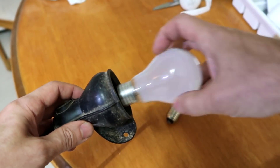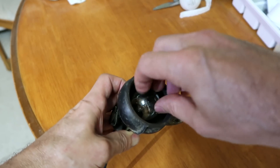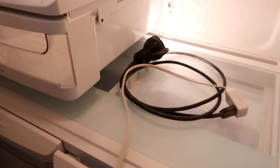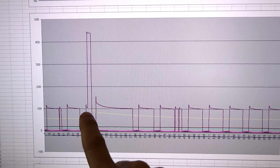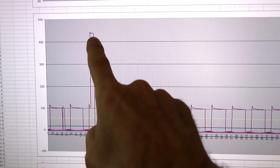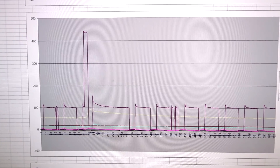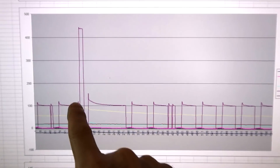That's kind of disappointing, so I'm switching to a 17-watt appliance bulb, also making sure the part going through the seal is a flat extension cord. The fridge consumed over 400 watts for about 20 minutes — that's the defrost cycle, which melts the ice off the coils that cool the air in the fridge because ice accumulates there.